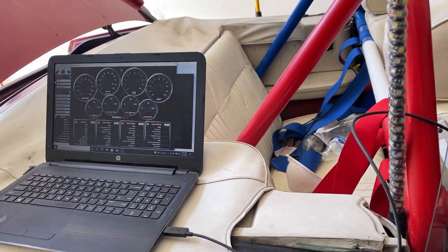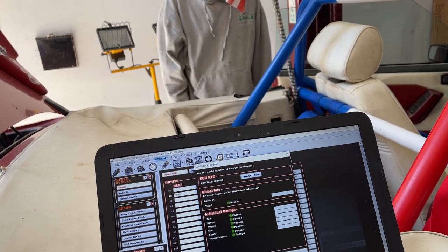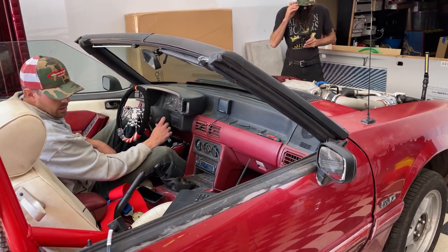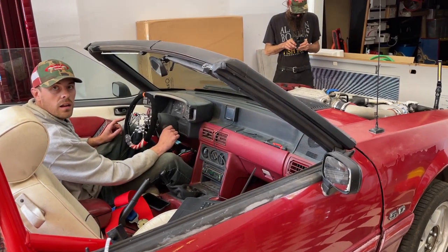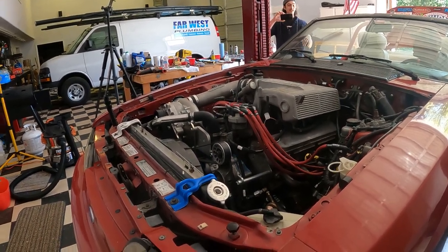I know, but it's gonna be over here in a second. Yeah, you want to turn it on? USB linked, passed. So now we're live. So what am I looking for here? AFRs. Okay. And what am I wanting it to be at? Anything 15 and lower. If it goes higher than 15. If it's like, yeah, because it might need to wake up for a second, you know?